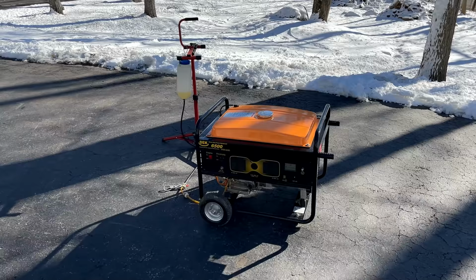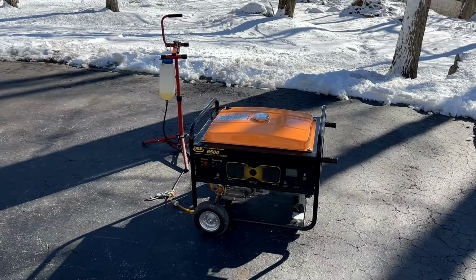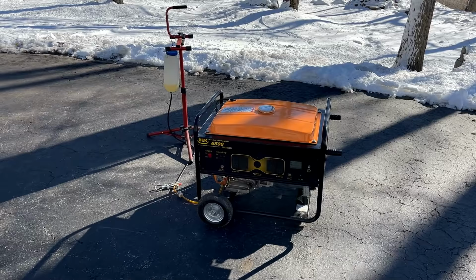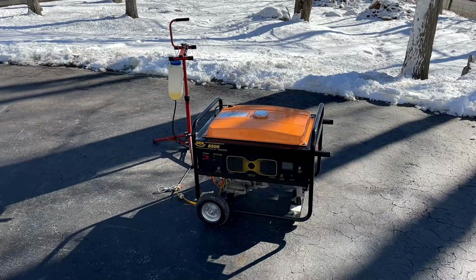Overall, not too bad. It started both times, second pull, no popping out of the intake or the exhaust. So I think the plug I pulled out did a little bit better job starting the engine, but to be fair, it is a really cold day out, so I'm sure it'll be easier to start on a nicer day. Anyway, this thing is done. It's making power, the engine sounds good, and overall the repair wasn't too bad. I would say about $45, maybe $50 in total in parts to get this thing back up and running again. So I hope this video helps someone. Thanks for watching.